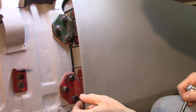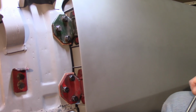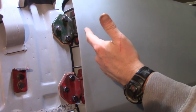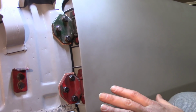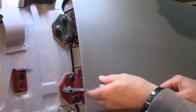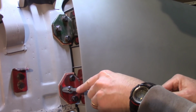So now what I think I'm going to try to do is tighten these hinges up. Door really can't come back any further. Tighten the hinges up on the B-post, and then try to pull the back, or excuse me, the bottom out just a tad, which hopefully will be from the hinge points that are attached to the door. And then I think, holy cow, I might get lucky and have it good.